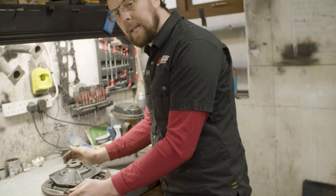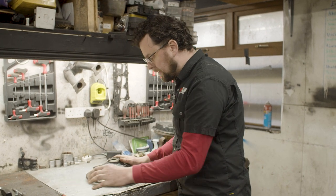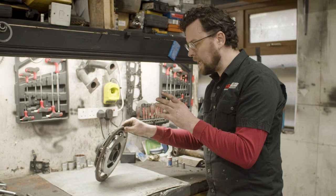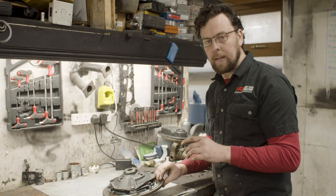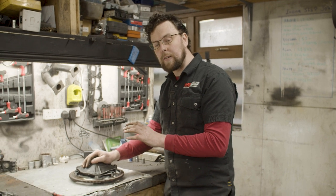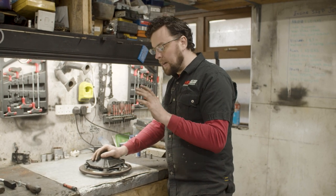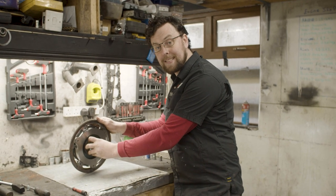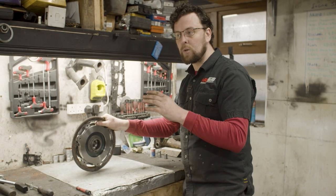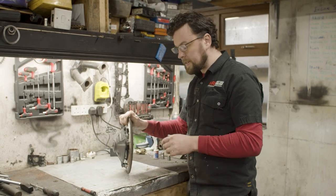There are a few things that get missed on these assemblies. Generally speaking they will work out of the box — this will work — but it isn't optimized and there is a good bit to be gained from optimizing it. You'll get a lighter clutch pedal. This is an orange diaphragm and as it's set up right now the clutch pedal will feel very heavy to press. When we optimize this we'll have the clutch pedal feeling lighter to press. We'll also get more holding torque on the clutch itself so it will be able to take more power from the engine without potentially slipping.